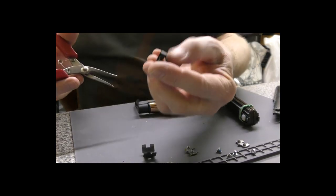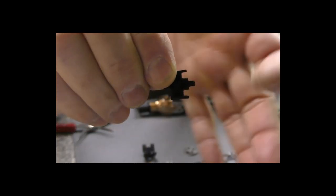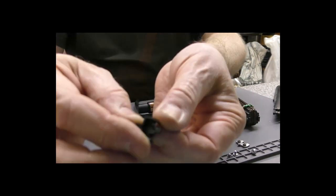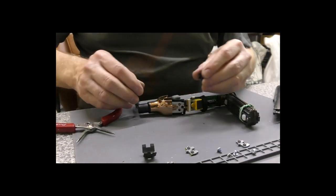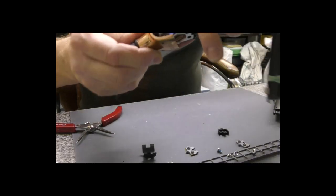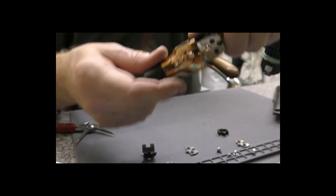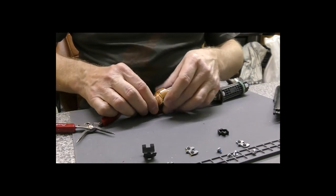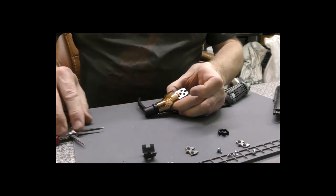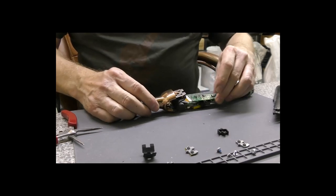There we go. So again, the live and neutral wires go through those slots here, if you want to call them slots, and the prong goes the other side. So that's a way to remember. There's a big hole there, and that goes into the plastic, and the two slots go into the mains cable. Now, at this point, you can see that side and that side, the two plastic pieces of this insert that you need to press together. So if you reach in with two fingers side by side and squeeze those plastic pieces, you can then see the way that's come out. Squeeze the plastic inserts. We'll show you that more closely when I take this out, and just slide that out.